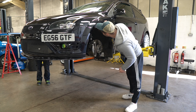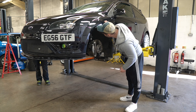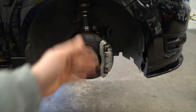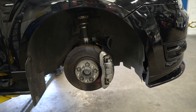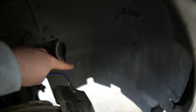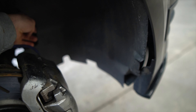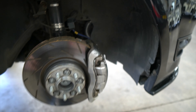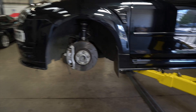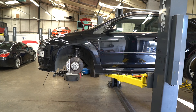You all looking healthy in there, boys. Seems okay so far. Right guys, just as we've been taking off the wheels, I have noticed something. I mentioned to Alan that I'd been having a scraping whenever I was turning, but it was so irregular that I kind of didn't really worry about it too much. But just near the air conditioning pump in here, you can see that it's been rubbing and a tiny bit of plastic has actually come off. Interesting that it's done that, but thanks to Alan he's obviously picked up on it. We've got all the wheels off now, so we need to really get to adjusting this car and try and have it set up perfectly.